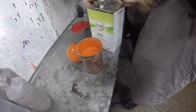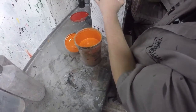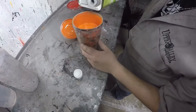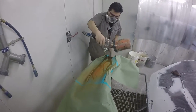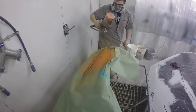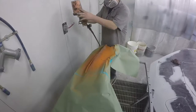We're using UR-50 with orange base coat. We were originally going to do purple and yellow but didn't have purple in stock, so we went with orange. I'm mixing the orange paint with some UR-50 reducer — it's a universal reducer that can be used in many applications. It thins the paint so it sprays properly; if the paint is too thick, it won't spray right. Make sure to do very light coats when spraying the flames rather than pounding on layer after layer. Here are the flames afterwards — nice, even, and fully covered.